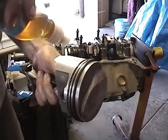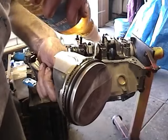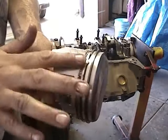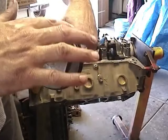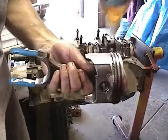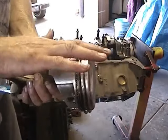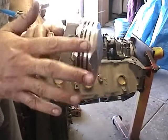We're going to put some assembly lube on this piston. One thing I failed to mention before is I like to try to pour a little bit of extra oil in that oil ring gap — get that thing filled up. That'll help out a lot when you first start it up. But make sure you get all the aluminum stuff wet; that's the most important thing. You don't want any metal-to-metal contact when you put it together. Fill up that oil ring and get the whole thing lubricated.